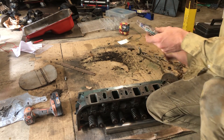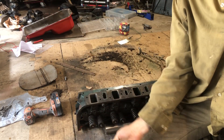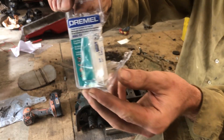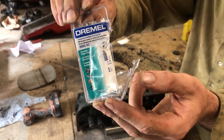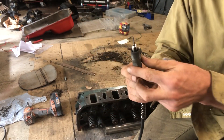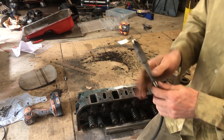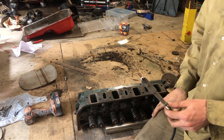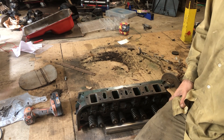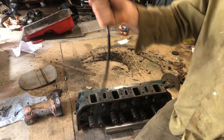First things first, you need the right tool for the right job. This is just a Harbor Freight Dremel knockoff grinder tool, like 30 to 40 bucks — they're not very expensive. The key here is the type of grinding device you want to use. It's made by Dremel, it's called a tungsten carbide bit, fine grain. The model number is 9901-03 — it's a really small little head and an unbelievably hard piece of metal that'll cut through anything except aluminum. This works on iron heads. This is an International Harvester 392 engine, which a lot of these old workhorses are known for terrible cylinder head flow, and we're going to try to make some small improvements. So the first tool you need is a grinder and a tungsten carbide bit.